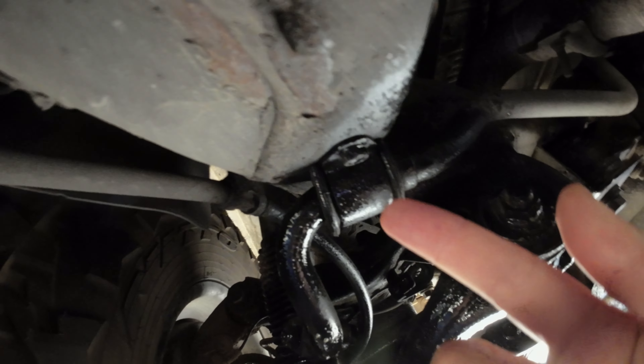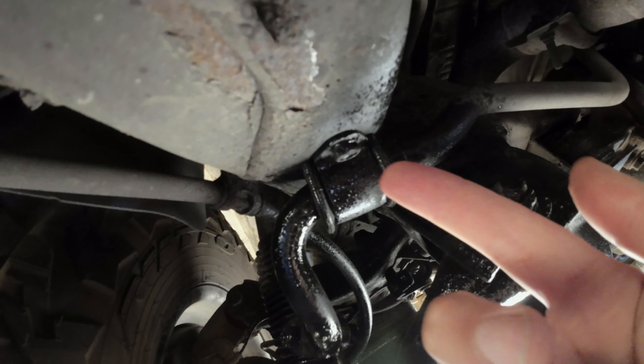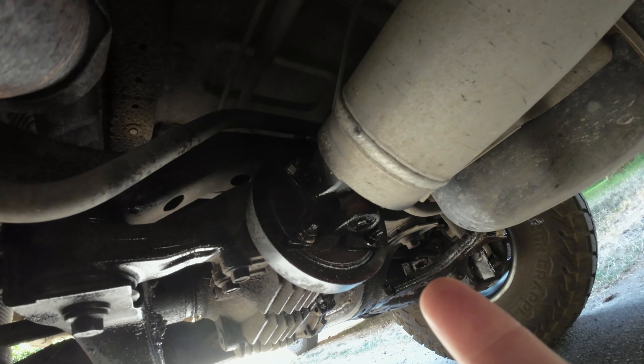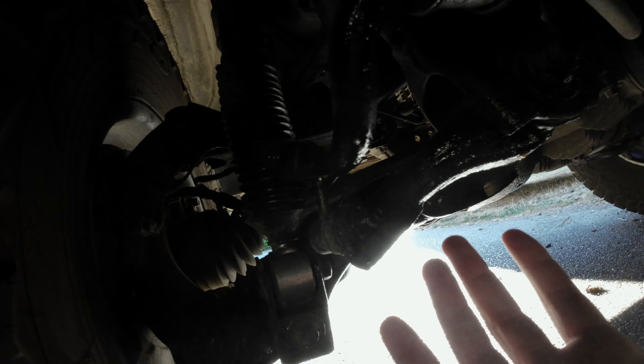In order to get the rear sway bar off, you're going to have rear sway bar end links in front of the rear tires, two rear sway bar brackets with poly bushings that go into the frame, and you're going to have to drop the rear drive shaft at the pumpkin. If you're looking at the under-frame of my car and saying 'my god, that's so greasy' — it's because I just applied a whole bunch of fluid film on here. It's summer here in Washington, so that was a great time to apply fluid film all over the undercarriage to prevent winter rusting. Fluid film will also help break some of these nasty bolts loose. I'm not optimistic — rear sway bar end links love to break on me.